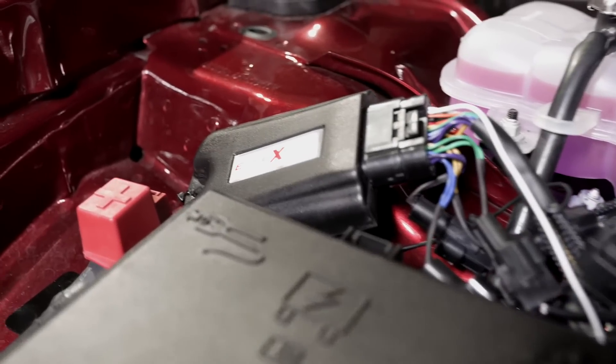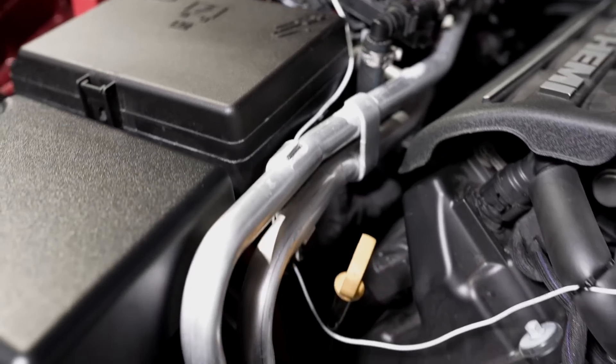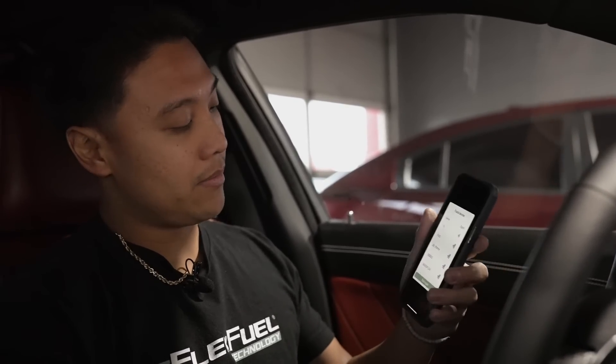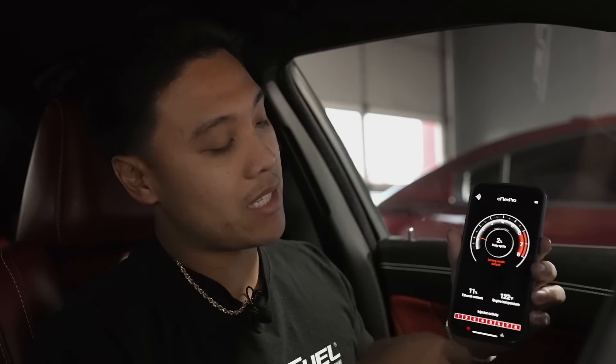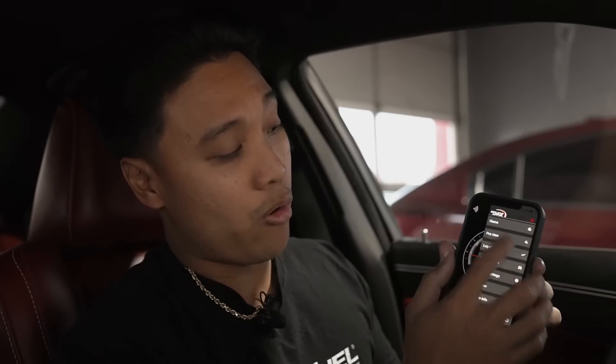The Pro Kit is supplied with two analog wires. These wires can be connected to the vehicle's own or external sensors. The gray wire is not necessary to install on this Hellcat. We use a soldering iron to solder in the white wire to the map sensor. Now that the installation is complete, start the car up and connect to the app. Everything has been connected properly — you can see that all the injector activity is on, the ethanol percentage is reading, and the duty cycle reads in real time. Since we soldered in the white wire, you can also check the Pro-View.